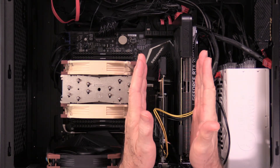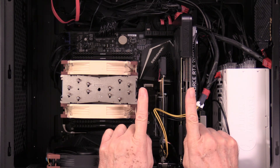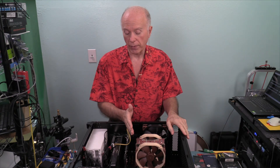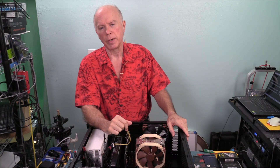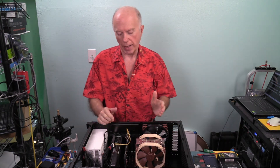If we have two 16-lane slots with two quad cards, that raises the question: do we utilize quad cards for four drives? On a 16-lane slot, four drives, 16 lanes — four by four by four by four — with bifurcation from the BIOS. People have asked how many quad cards we've put in a machine. Based on resources, we could only put in one. But based on what we're looking at now with GRAID, I'm trying to figure out how to put in two. We haven't installed four quad cards because we didn't have the resources, and that's what the WRX80 is all about.